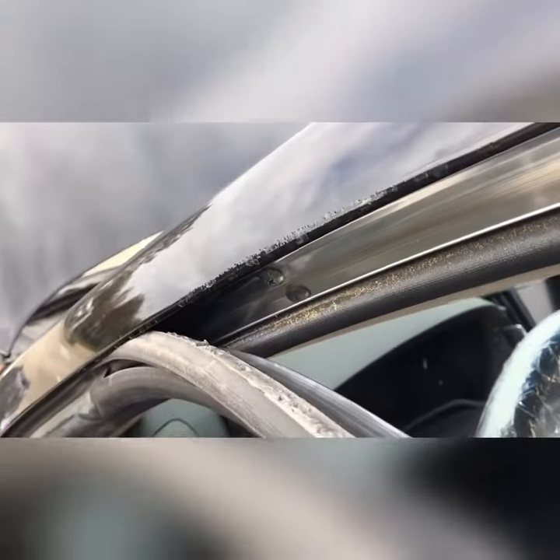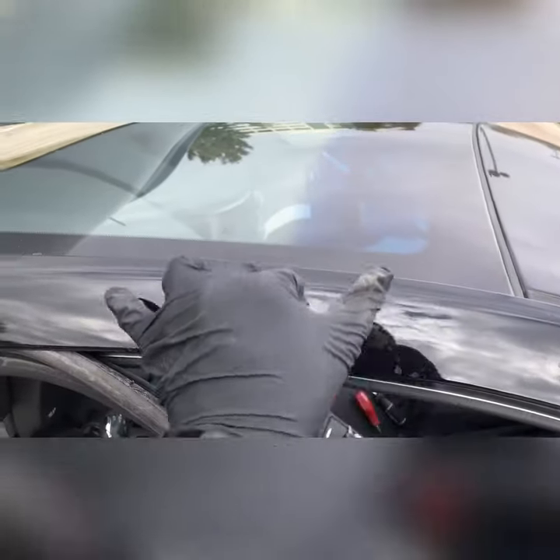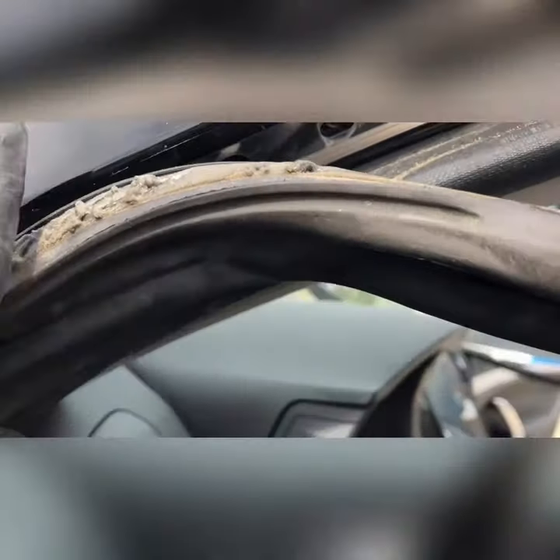That aluminum bracket is holding this down with those little plastic clips. You need to be careful when you get towards the end — if you look at the top here, about a foot or so in, there's actually a plastic clip holding this rubber too, so you don't want to mess up the rubber. Stop right there and make sure you don't break that plastic clip holding the rubber. Carefully take off the double-sided tape.